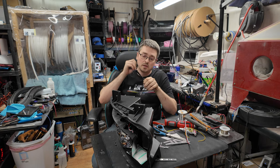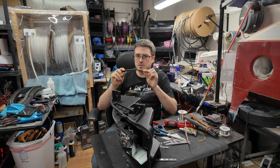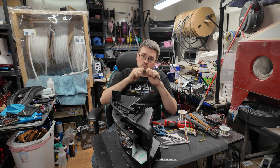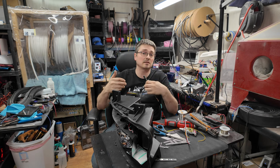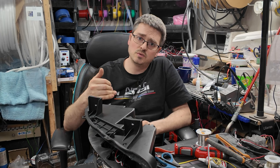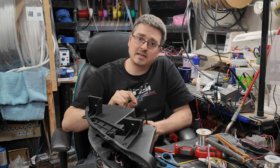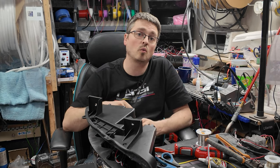And then I will use one of those plugs that I was talking about, one of the waterproof barrel connectors. Now, these in general for me have proven to be a lot more sturdy, being that they are factory molded. So, you know, yanking on the wires to connect and disconnect, it's a lot less likely that wires are able to pull out. Historically, in the past, I used pin style, where you push it into the back of the connector and then it snaps in place, and those do generally work well.